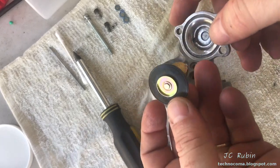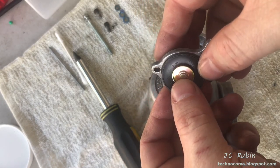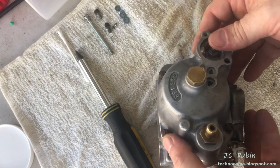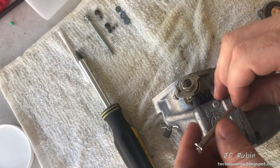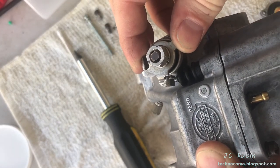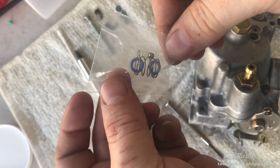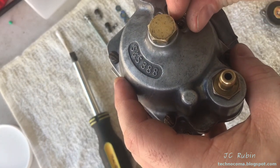Next would be the diaphragm for the accelerator pump. There's only one direction the diaphragm neatly fits within this machined area — we can see how that goes in. Take the rod and slide it down, turning it around and making sure it came safely through the other side without poking the material just replaced. There it goes through the material — butt it up against the mechanism that pushes it down. The rod is now seated just about flush in there. The final pieces are contained in a package within the package to ensure they don't get lost. I'm going to open this up now — the first thing I'm going to do is drop that little spring down the hole.